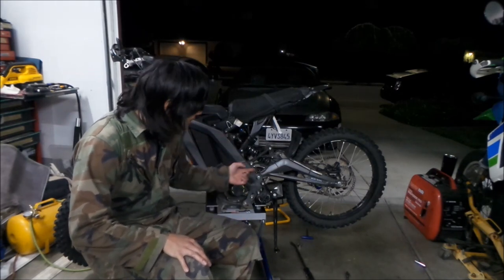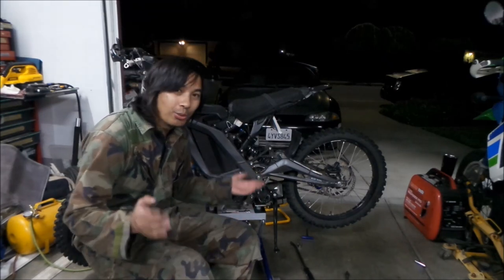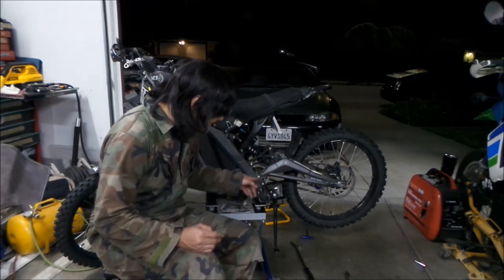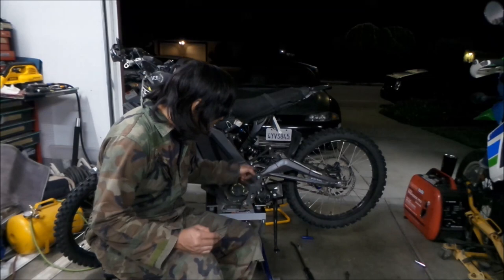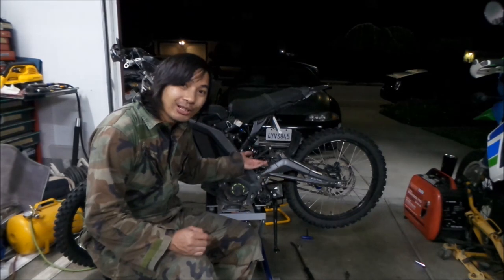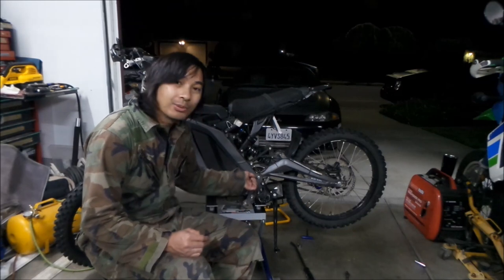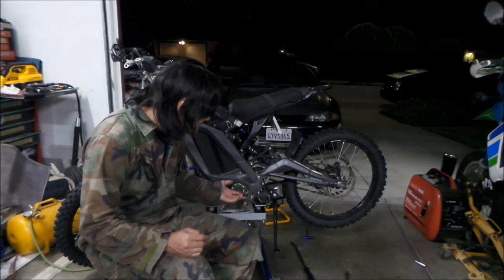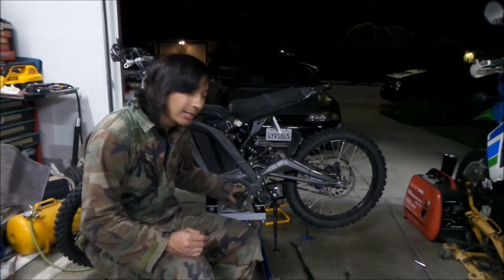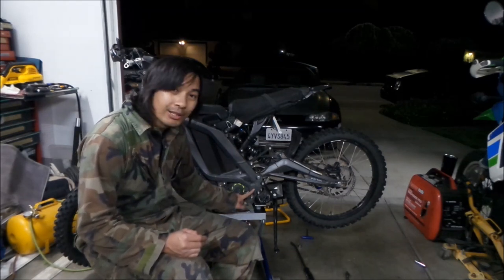I think the hardest part is getting the jack shaft assembly to line up with the swing arm. There's just so much stuff going on with the swing arm. You've got the bolt, you've got the frame, there's some bearings in here too. There's a spacer, there's a jack shaft, and you gotta get that through all of that, and then there's another set on the other side that you gotta get it through. Hayes thought I had trouble getting it through there. And then I found out the belt is too tight, so I had to loosen the belt. When this bolt is up here in the slider, it's loose.